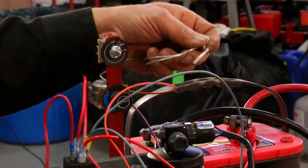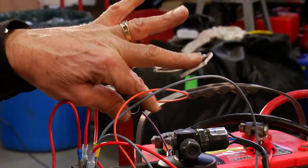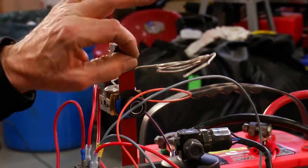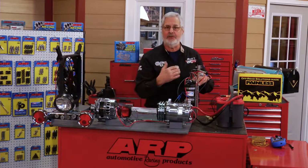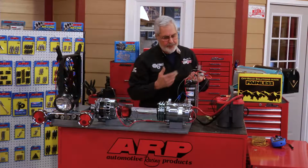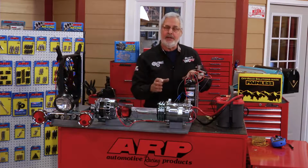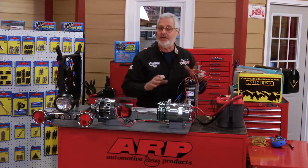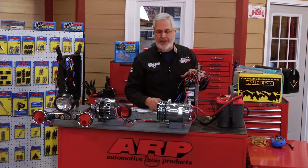You've got two switches on your AC system: your on/off and blower speed, and your thermostatic switch, which is this one here with the capillary tube that goes down into your evaporator. That's what cycles your compressor on and off as it gets cold, right? This switch is rated at about 4 amps, particularly on Vintage Air's Gen 4 electronic system. It's solid state. It's got digital stuff in there.